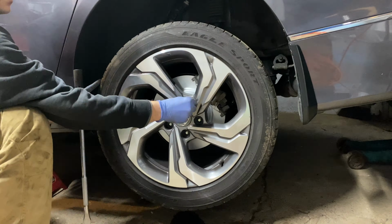Start the vehicle and depress the brake pedal several times until the pedal becomes firm. Recalibrate the electronic parking brake by engaging the parking brake and releasing it at least twice. The first time it is engaged, it will take longer as the actuator travels to engage the brake.